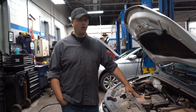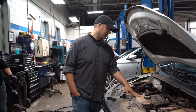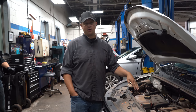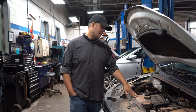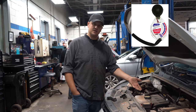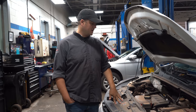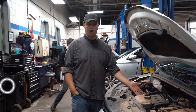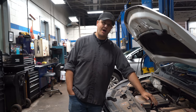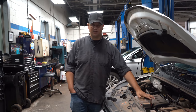While you've got the hood open, you can check your fluids. Antifreeze is one of the most important, especially going into winter. You're looking for antifreeze that's good to a certain strength — roughly minus 40 degrees is where you want to be. You can buy a checker at any parts store; it sucks up the fluid to a line and a little needle tells you exactly where your antifreeze is at. Most bottles have a low and a high mark — you want to be somewhere in between depending on engine temperature. If you need to add some, don't open it when the engine's hot; wait till it cools down because it's pressurized.